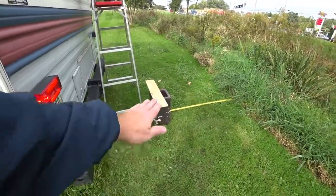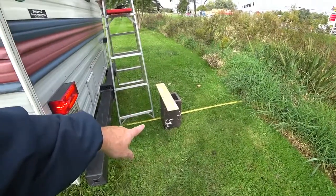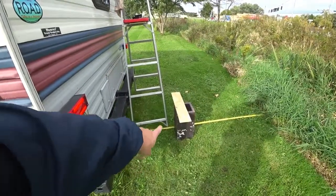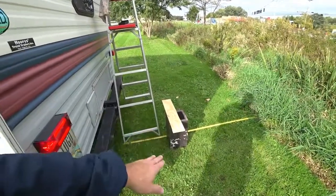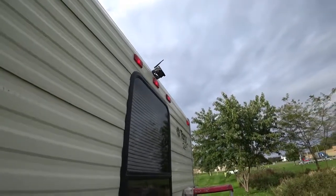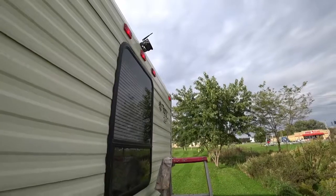Make sure that you set it up higher, because if you check 2 foot on the ground, it's completely different. That camera would have to be pointed down even more. But the most important thing that you should be concerned with is what your bumper is going to hit. And at bumper height, we're at 2 foot there. So the camera, the way it's set up right now, you can see it's pointed relatively straight down, and still giving a pretty good range, not only down but back.